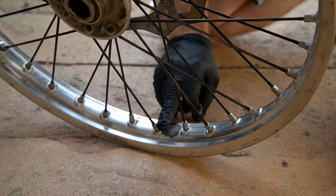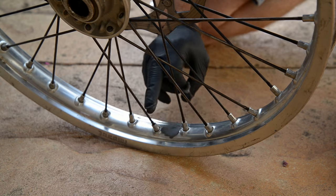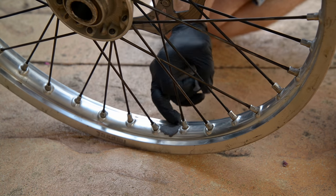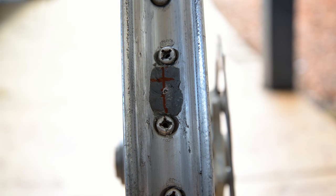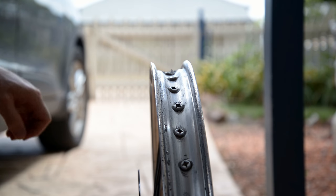When I applied the quicksteel, the amount applied has to be larger than the hole on both sides of the rim for it to stay in place. I marked where the hole is going to be — in the centre of the spokes is a good spot. Then drill the hole slightly larger than the tube valve stem, and put it in.